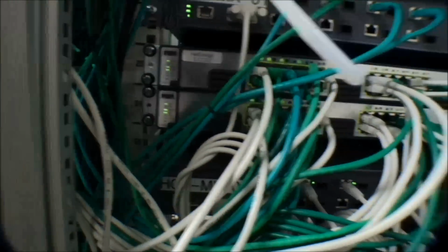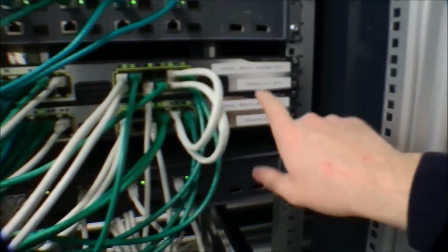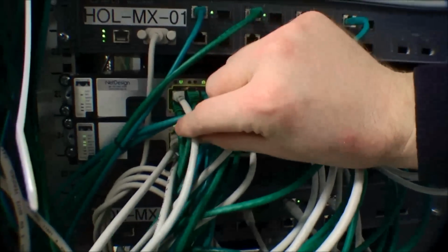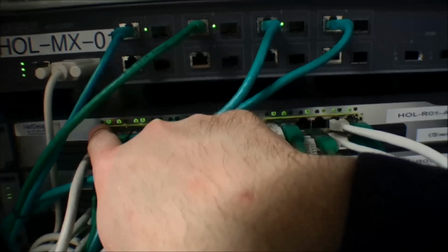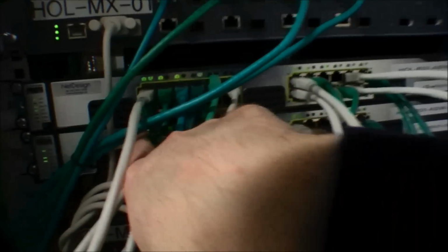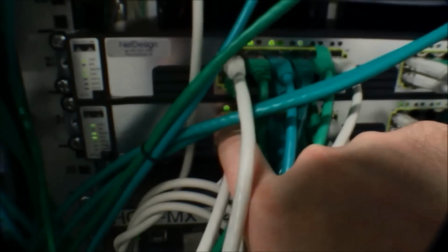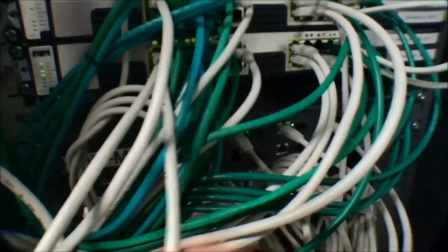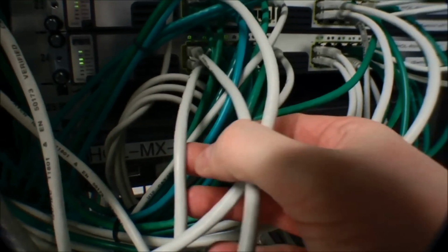We didn't have more than 1 power strip here, so we use 2 switches. Each of the network connections goes into one of the switches, so we can actually have maintenance on one switch and the server will not lose connection. And on both switches I have connected the network to port 1, and on the second switch I have put in the IMM in port 2, and I'll have to configure this later on.